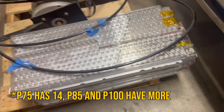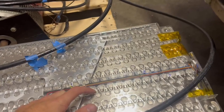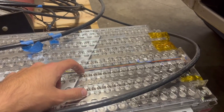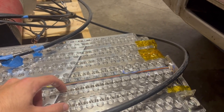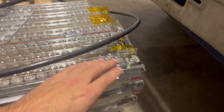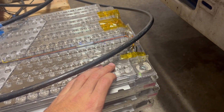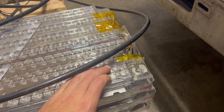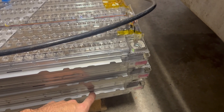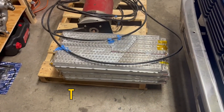A full Tesla pack has about 15 of these modules in it. I bought these from a shop down in Portland that repairs battery packs, because Tesla won't repair them — they just replace the whole pack, which costs about $20,000. There were 14 good modules in that pack and one bad one, so I offered him money for three of the good modules. Each module is 22.2 volts nominal, and connected in series the three modules will be a little over 72 volts, with just under 200 amp-hours of capacity.